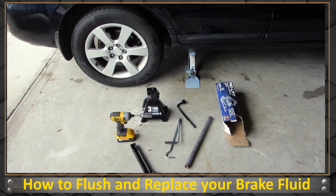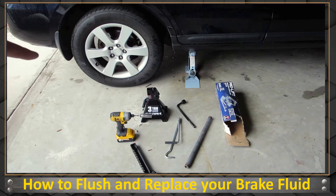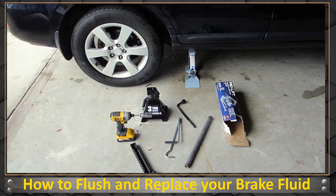I added a couple more parts — I got my jack stand, a ProLift, and a lead pipe to help me get the lugs off the wheel. I got my drill with a large spark plug socket which fits the lugs, so I'll manually remove the lugs with the wrench and then use the drill as it gets loose. I also got a three-ton jack to hold up the car, and I might have a second support as well — I don't take chances with supports.